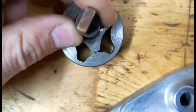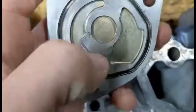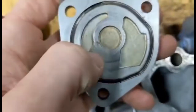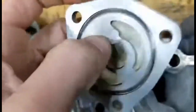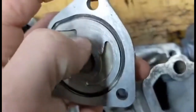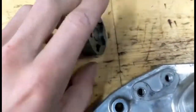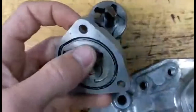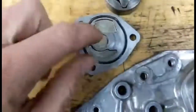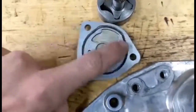I just replace these because I can get them from the dealership. The biggest thing to look for is big gouges here. If something gets sucked across this front cover, it'll damage it really bad, and that will lead to oil seeping past the pressure side on the outside. So you're just looking for anything super aggressive. And if you take this cover off, replace the seal ring — it will leak if you don't. You have to replace that O-ring.